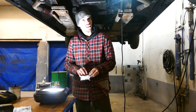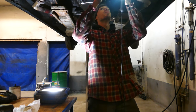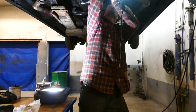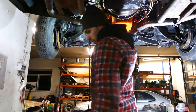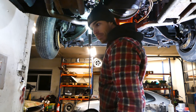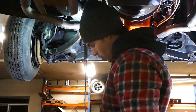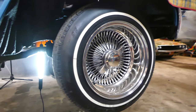As you guys remember in the last episode, these exhausts have been leaking very bad, so of course we got some new seals here and I'm just going to see if I can pop them in. It's one of those moments where you can't see the bolt but your fingers just got to do the job. We are threading on, baby. Cross thread — better than no thread. Both manifolds in. It was a little bit of a hassle to get some of the nuts in there and the double gaskets and stuff, but it's in there. Man, I'm bleeding. That's great.